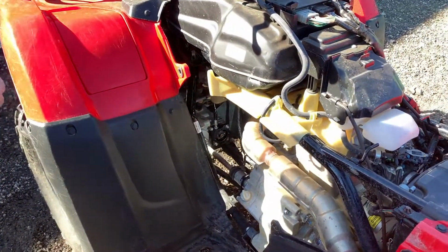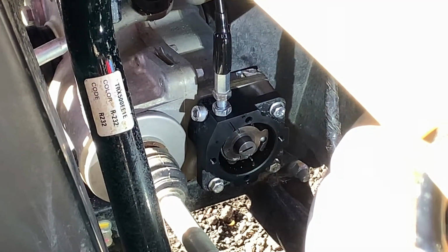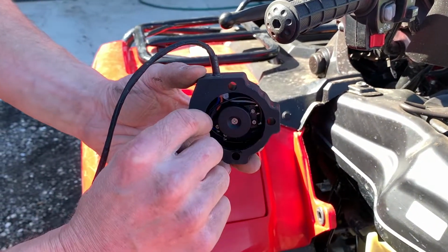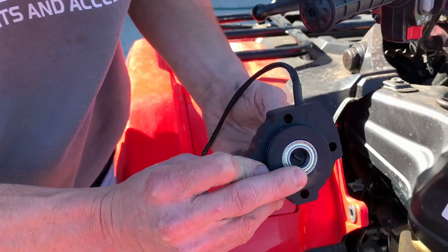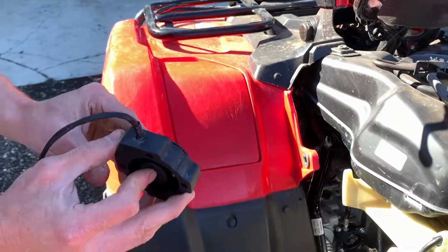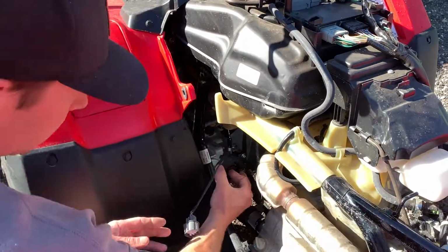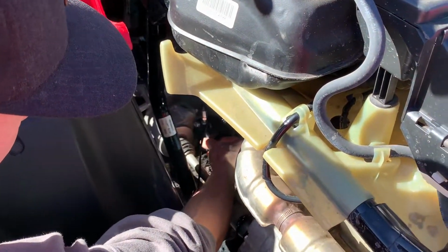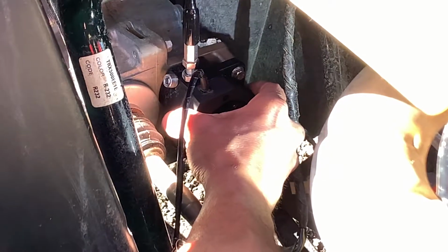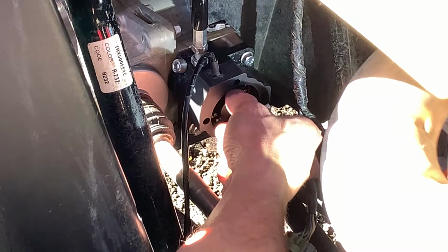So in the 2-wheel drive position, you can see that it is horizontal. And so you're going to take this part and rotate it all the way counterclockwise. Then look at the back and go a little bit clockwise to get it horizontal. Now, when you assemble this, you'll feel this slot slide into that slot on there. So line this up, push this on. May need to rotate it just a little bit to get that slot to line up. And just like that, you can see them flush over here. It's all the way on. And this is locked in.